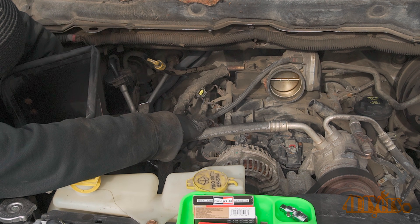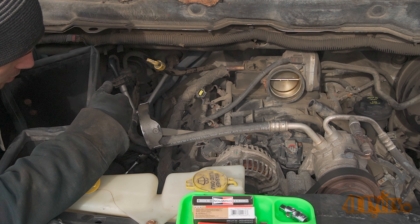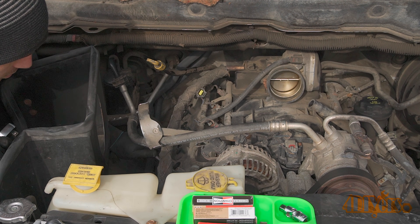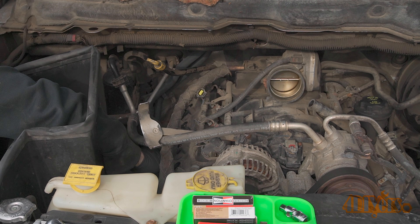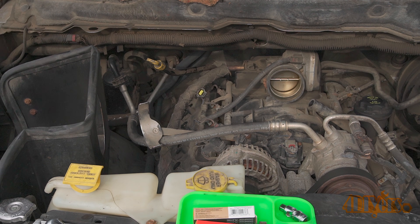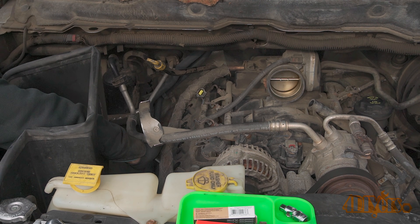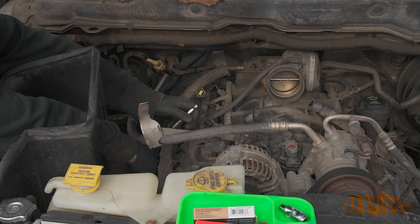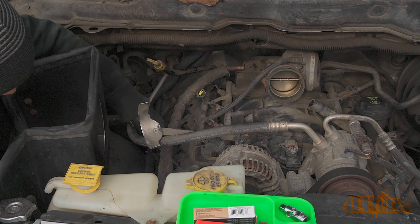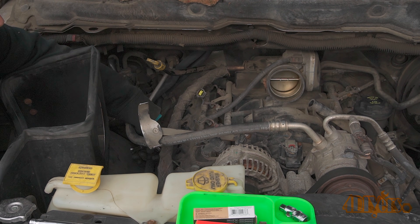Now I was removing each of the spark plugs and replacing with new ones as I go along. The green tray on the fan shroud is my OEM Tools 22417 flexible silicone tray that comes in a set of three. This keeps all my parts and tools organized and in a safe location so nothing falls down in the engine bay. It's able to withstand temperatures of 500 degrees Fahrenheit and is protected against any chemicals. A link to this will be included in the video description to Mobile Distributor Supply. The torque specification for the spark plugs is 13 foot-pounds or 18 newton meters. If you are gapping the plugs, the required measurement is 45 thou or 1.14 millimeters.